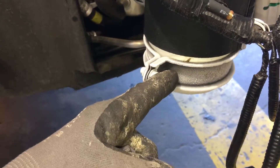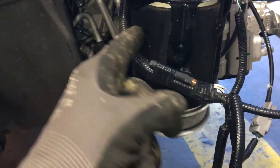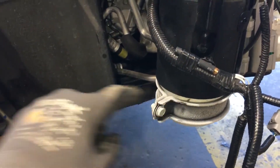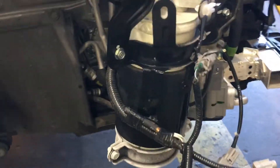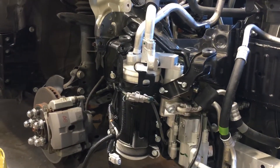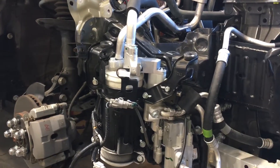This is the second video on this Prius Prime. Here we are back with a frozen up component which is insulated, with a lot of water here all freezing up. This is saturated with liquid refrigerant inside it, trapped with several ounces of oil inside of it. This will cause shops and owners lots of expense and lots of frustration.